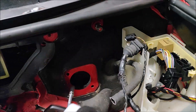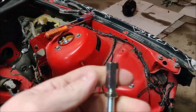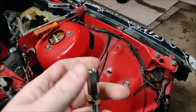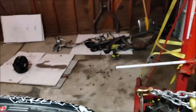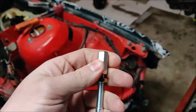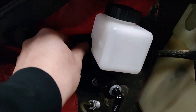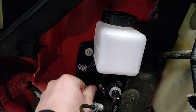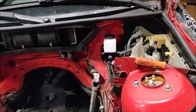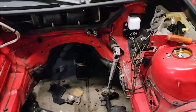No instructions, so this thing is just supposed to go right here — it's gonna be pretty sleek. I gotta take some of this padding out because it'll hit, and then I have to basically take this nut off. On my stock master cylinder, instead of cutting off the clevis and welding it onto this nut — because I want to sell it hopefully — I'm just gonna get a piece of metal, drill a hole in it, and weld it on. Basically this is where it sits; it gives me a lot more room compared to the brake booster which came way out.